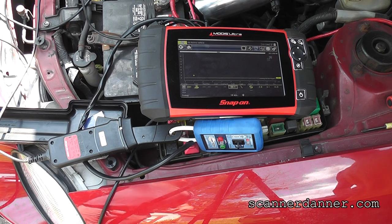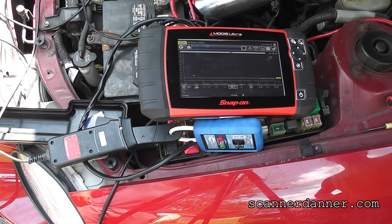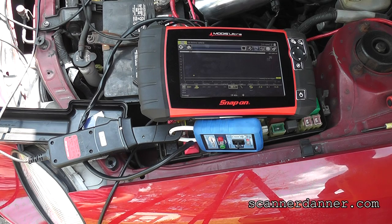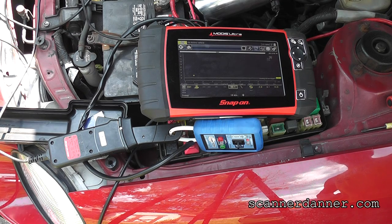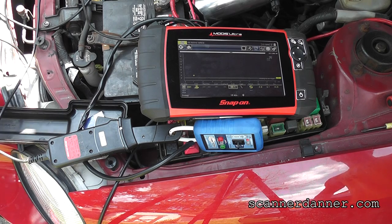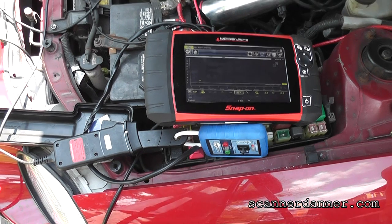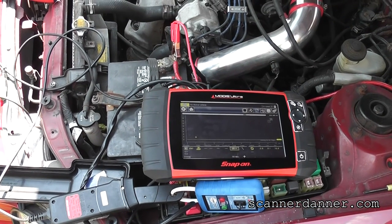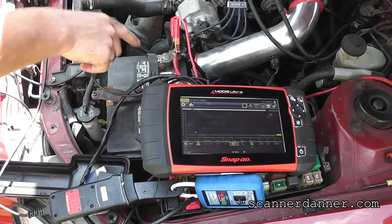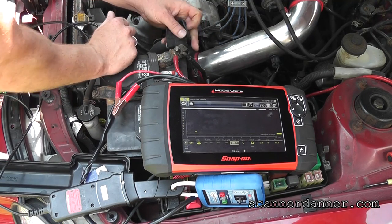But what that means though is my smaller wire on the starter, I don't need to check it. It's my larger wire that I have to worry about, because we could have an open, and that would be sweet if your heavy cable to your starter was messed up. Like one of these cables on your battery, because they look like crap. You know, if it was as simple as one of these guys being loose or corroded, and it absolutely could be,